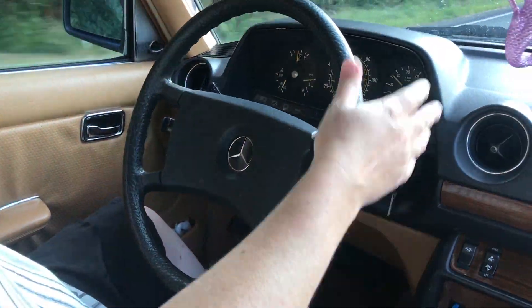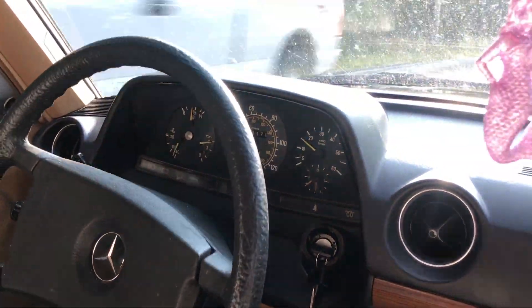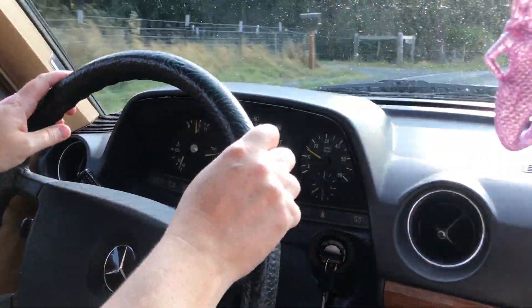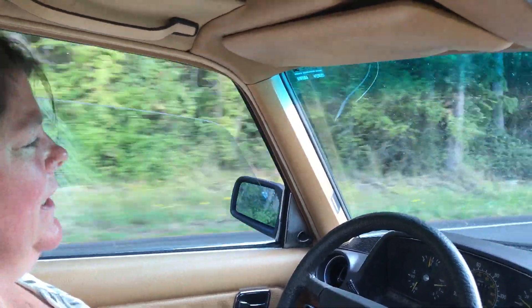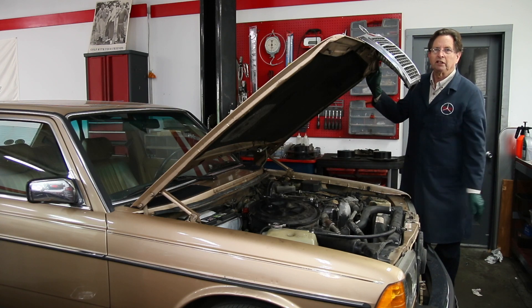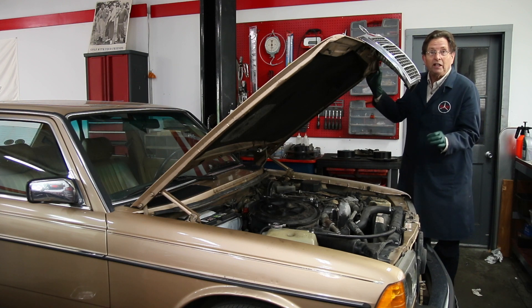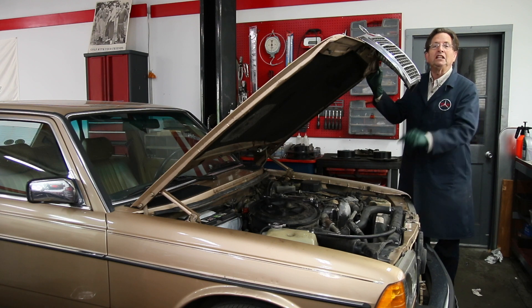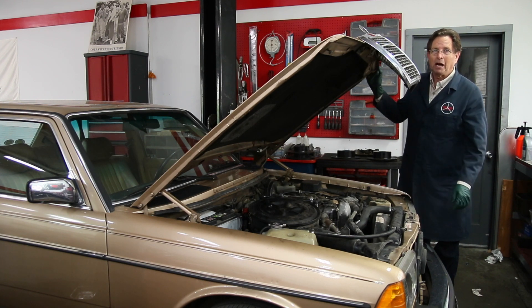Look at the steering - no hands! Check the play. Wow, super tight, no steering play. That's really unusual for a diesel with over 190,000 miles. Sure enough, all the way home she had a jerking transmission. If your transmission jerks when it shifts, that's actually a good sign, because it probably means there's something wrong with the vacuum getting to the transmission. If the transmission slips too much, that's a whole different matter and can be a much bigger problem.